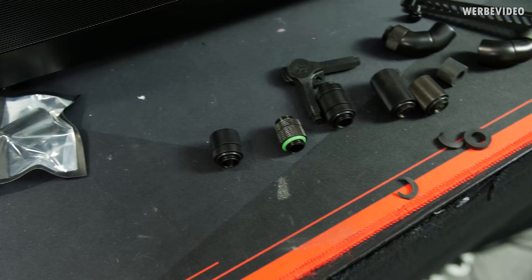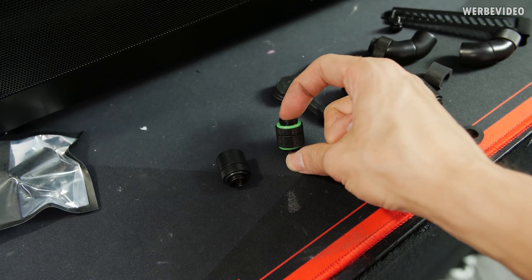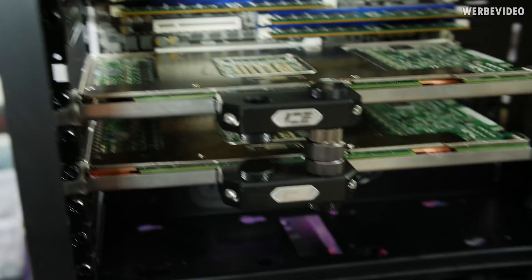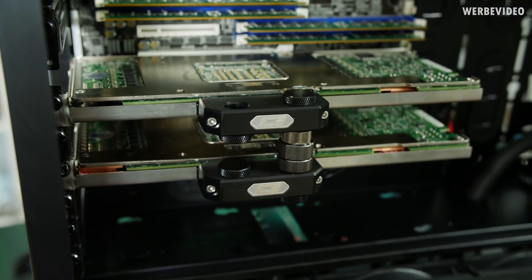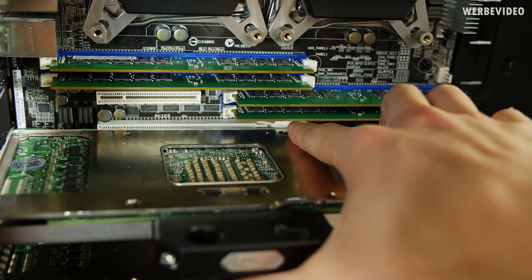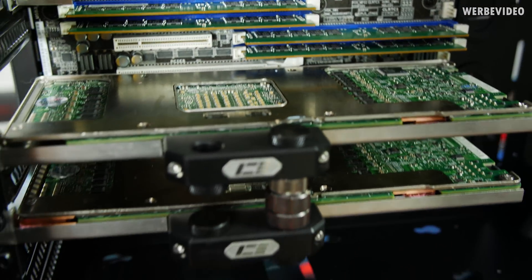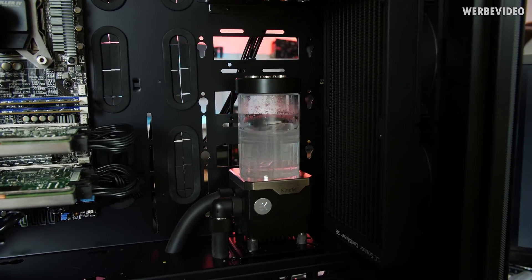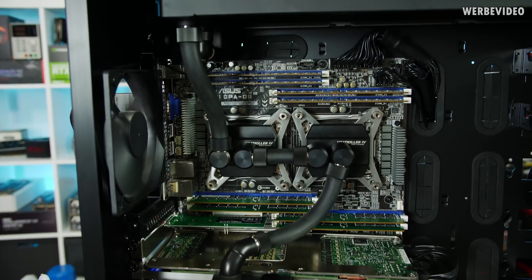The Xeon Phi is now finally sitting inside the system as well. I had to play around with pretty much every adapter I have - you can see there are still different combinations left on my table. The problem was trying to fit a twisting rotary fitting adapter in between: you install the rotary fitting in the bottom one first, then insert it into the top part - the rotary makes things a lot easier and gives much better stability. Also, the Xeon Phi doesn't have the small notch in the back that holds down the PCIe slot, which you may have noticed during disassembly, so this gives a little extra stability. Assembly is finally done, system is running, pump is filled - filled with Corsair XL5 fluid - running happily, looks great.